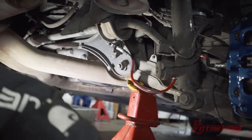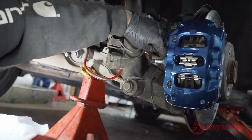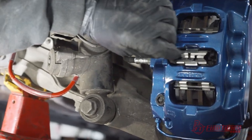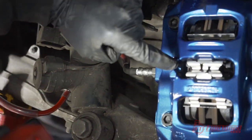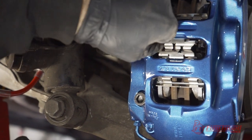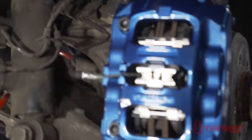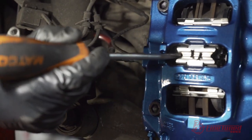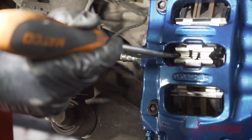The right rear has a brake pad wear sensor on it, so I'm just reusing the old one. It has a little slot in the pad for it and we'll slip it right in. I started it in the hole and then I just grabbed the flathead screwdriver and very gingerly pushed it in.